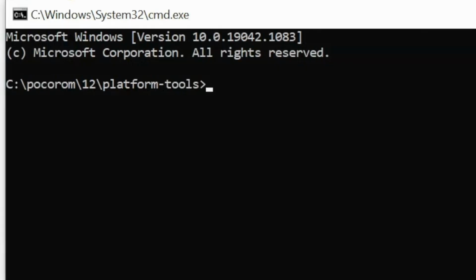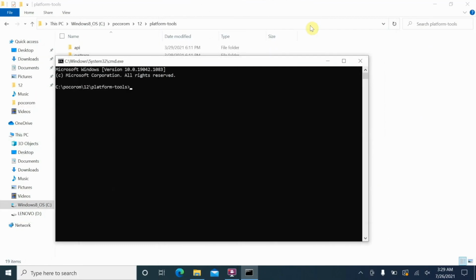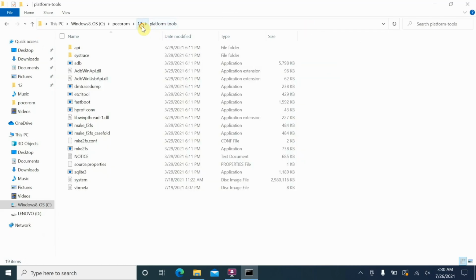Next thing, first of all, we need to check whether our device is being detected in fastboot mode or not, and the command for that is fastboot devices. Once you've entered the command, press the enter key, and as you can see, my device is being detected in fastboot mode. Now, if your device is not being detected in fastboot mode, that means you do not have the drivers installed. So make sure you have installed the drivers, which are linked in the description of this video.